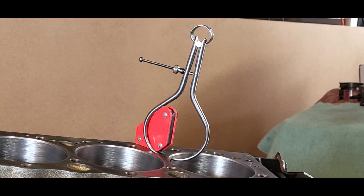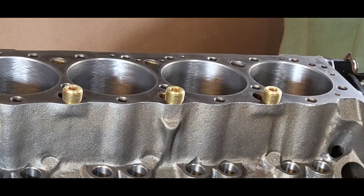There are a lot of things we do behind the scenes that never make it on camera. One is measuring cylinder wall thickness. On that score, we are under the impression that as long as you don't bore 30 over, your block is probably going to be just fine. Now if you were going to go 60 over bore, you've got to dial into this area to make sure you have a worthy block and that at 60 over bore the cylinder wall casting is thick. This one is just fine, but we're going to pressure test it and magna-flux it and we'll know if there's any problem.